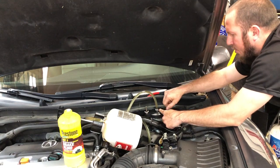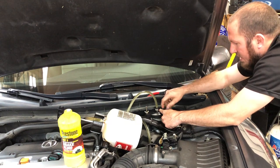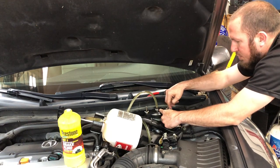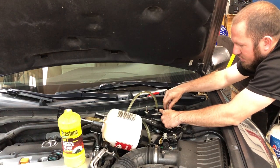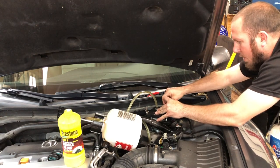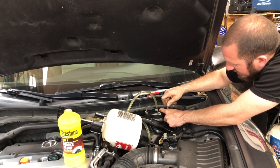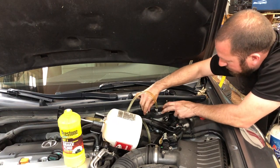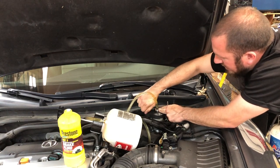A little trial and error when hooking it up to the master cylinder — every single one is different. This one's angled up like most Hondas, which is a pain. I put it around the big metal base here; we don't need it terribly tight, but it still needs to apply pressure on that rubber O-ring. I'll go ahead and recenter it. I love the adjustability of the wing nuts and hooks — it gives you a lot of options. I'll tighten this side down and try again.